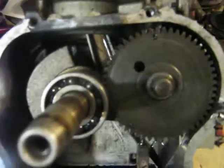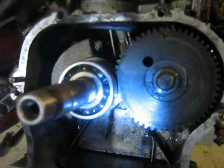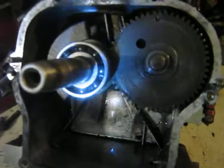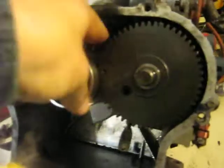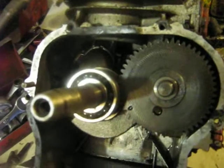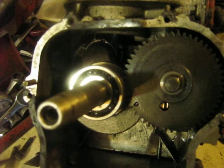Now racing camshafts could be different. A lot of these 5-horses with the roller bearings use racing cams, and because you can vary the lobes on those, the timing might be a little bit different. But this looks like how to set up a stock 5-horse Briggs Model 13 with the roller bearing. That dot on the counterweight needs to line right up with the dot on the camshaft. Best of luck if you've got one of these engines and you're trying to reassemble or time it.